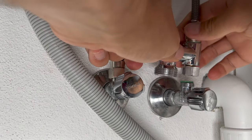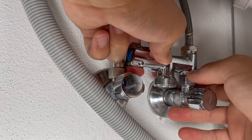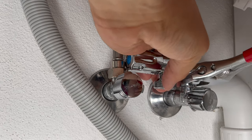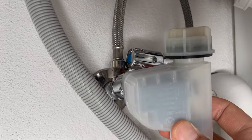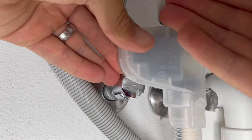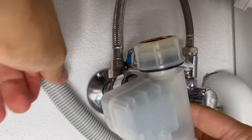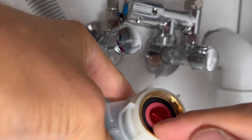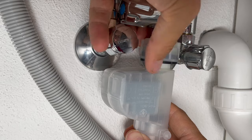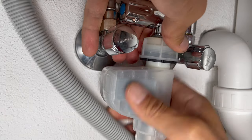Now reattach the water line. Make sure not to forget your washer — that way you'll have a good connection without any leaks. Now install the aqua stop. These are great because there's a water counter inside, and if it detects water flowing without the dishwasher expecting it, it shuts off the valve so you don't end up with a flood in your kitchen. It also comes with a black gasket inside. Righty tighty, lefty loosey. These newer ones have fins so you can tighten it enough without needing channel locks.